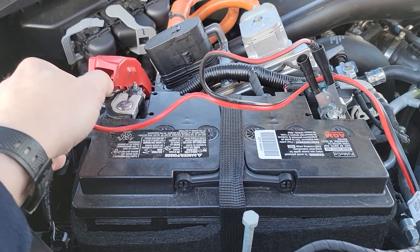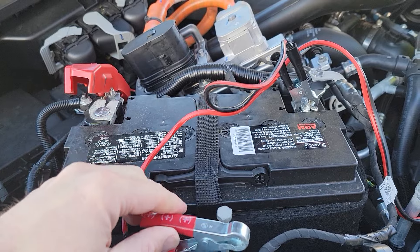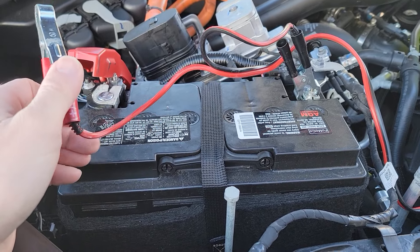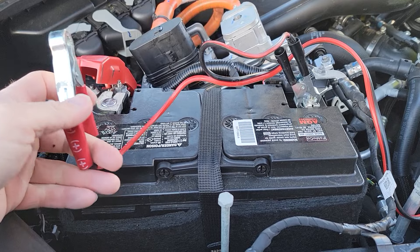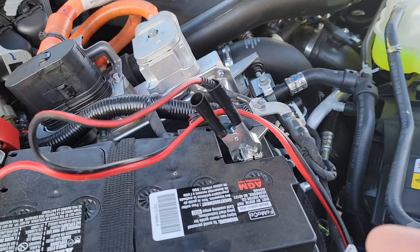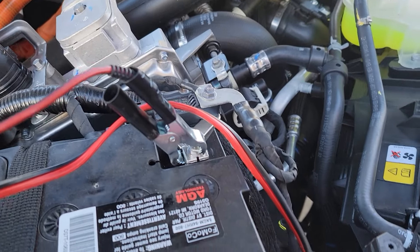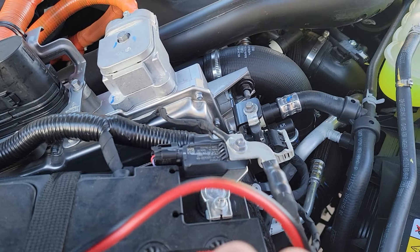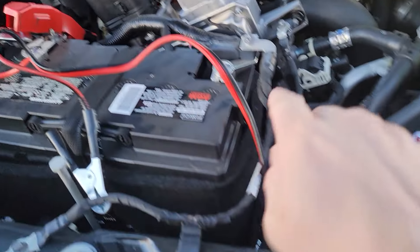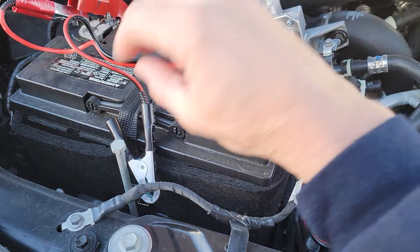You can hook the positive terminal wherever you can get it. If you have small gator clips, it might be hard to get on that post. If you're going to remove the battery and charge it off the vehicle, you'll charge it just as you would hooking it up to the post. But if you're going to charge in the vehicle — which is perfectly fine — you can take your gator clip on the positive terminal and hook it anywhere on the back side that you can get to. If you see any type of box like this near your battery connection, you can use any negative ground you want, or clip to the back side of it and it'll charge. In this instance, we have an auxiliary ground coming off here and going to the body or the frame, so that's where you would hook it on your F-150.